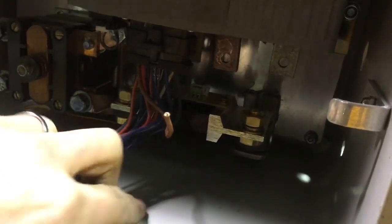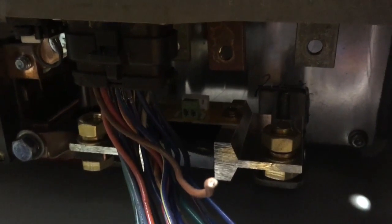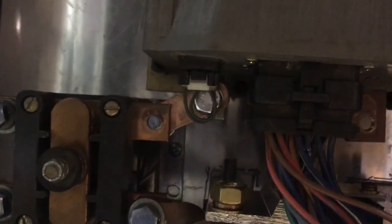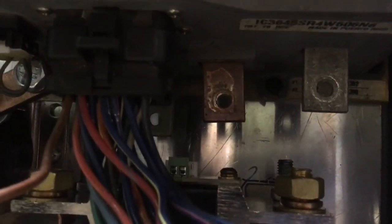Negative will feed right into this current shunt. The current shunt that you can see behind all that wiring mess then feeds through a twisted copper bus bar into the main contactor. When the main contactor is closed, it feeds right back to the controller there, and so that's the negative feed from the battery. Positive will come in — I think this one's the positive — on the controller.